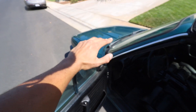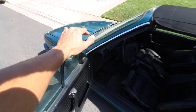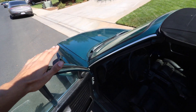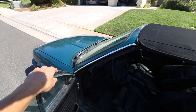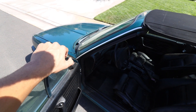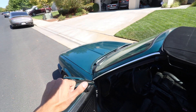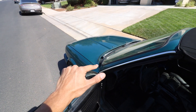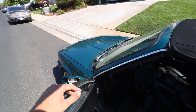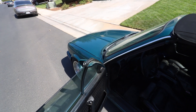There's actually coolant — there's not just water, it's not rusted out. The temp doesn't even get near the middle; it's at about a quarter, so I think this thing has a lower thermostat — way lower than stock. It might need a fan clutch. I have a thermostat housing, a new thermostat, and a water pump ready for it. It's already got new spark plug wires on there, so this car is pretty straightforward.